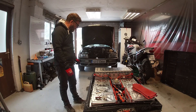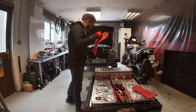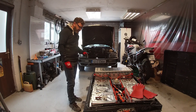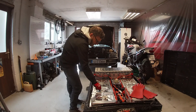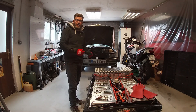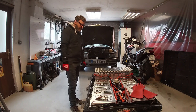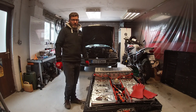For the initial couple of poles I'm going to take off, I'll have my high voltage safety gloves on. As usual, we've just insulated all of the tools I'm using, just in case something falls and bridges or arcs across a couple of poles. It's always wise to just keep a liberal coating of insulating tape around them.